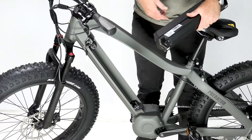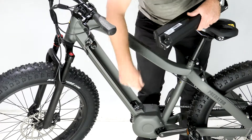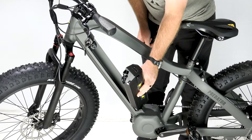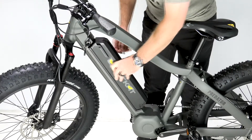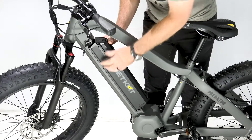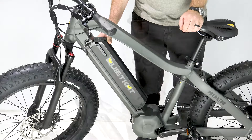To reinstall the battery in the bike, locate the clip section that's going to line up with the clip at the bottom of the tray. Enter in at a 45 degree angle, lining up the clips. Once those are in place, rotate the battery down. Watch out for the top of the frame and give it a good squeeze until we hear a solid click.